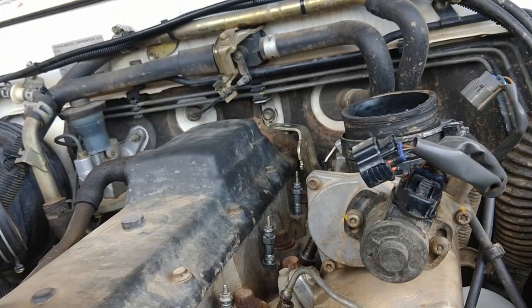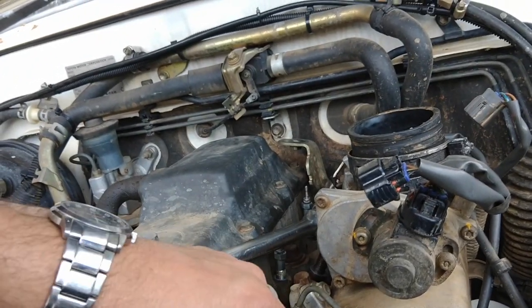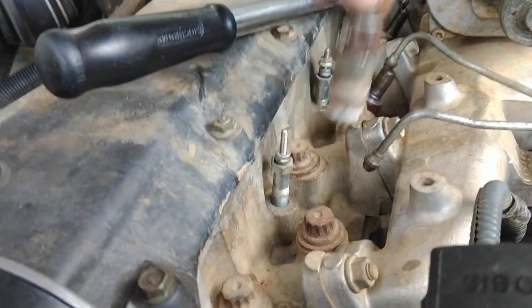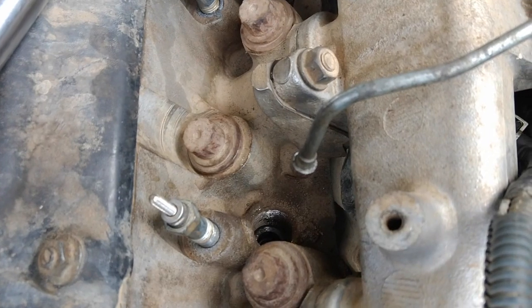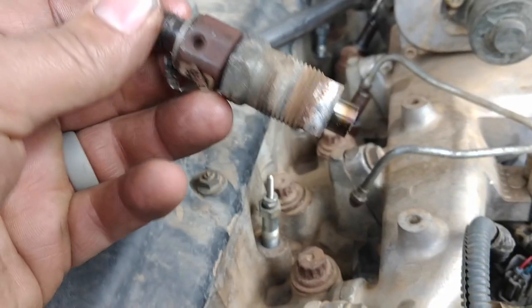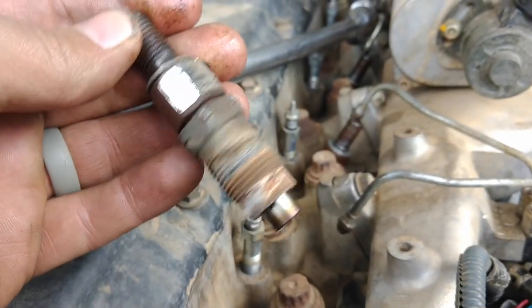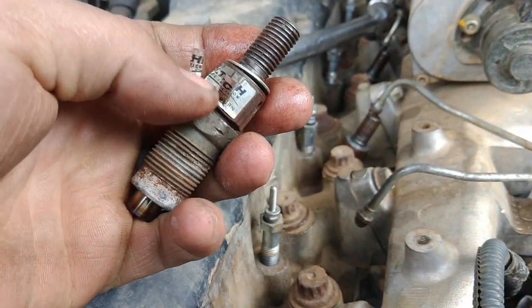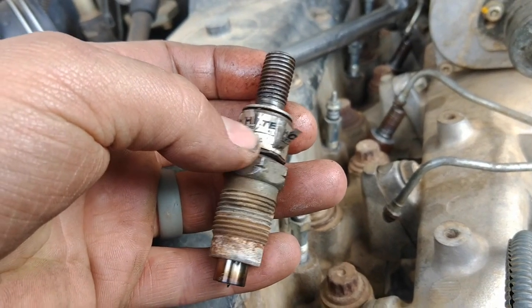So you crack all of them off. Once you've loosened them off they should just come out pretty easy. So this one here — undone. And that's the injector. I believe they're copper washers down there that you'll need to pick out as well. Go through and undo all of them, then I'll put them in a bag and take them to Hi-Tech Diesel. I'm getting these ones back — these are the original ones that I did probably 150,000 k's ago, maybe a little bit more. So I'll take them back there and get a renewed set.